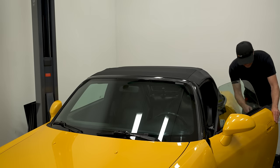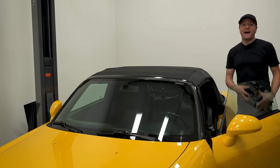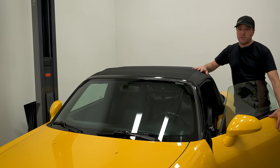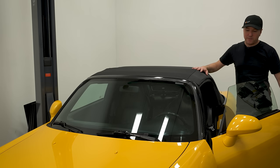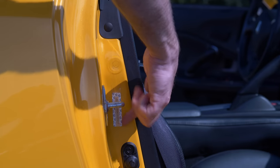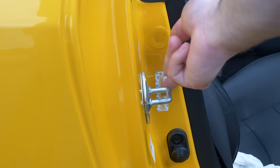Sometimes you won't find a VIN sticker on the inner part of the door. If you don't, and it was a factory Honda replacement door, you'll see a sticker that says 'DOT' usually with a Honda badge — meaning the entire door frame has been replaced. The problem with these doors is if the outer shell gets damaged, body shops will sometimes just replace the entire door, since it's easier than reskinning it. A door replacement isn't a big deal as long as you see the VIN in the inner cell by the door latch. If you don't see a VIN there, chances are this car was in a pretty hefty accident or sideswiped.